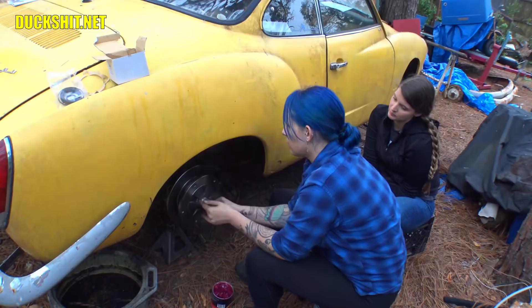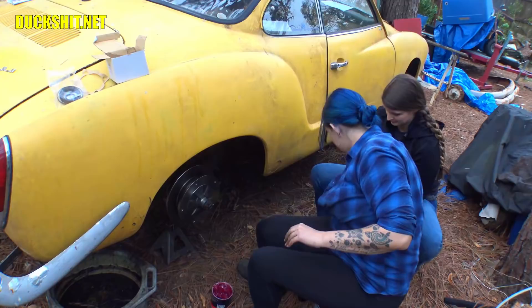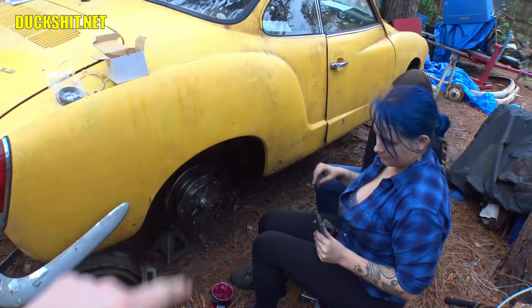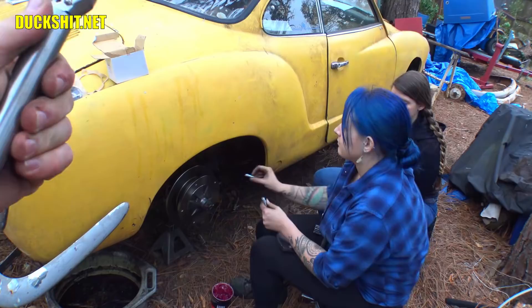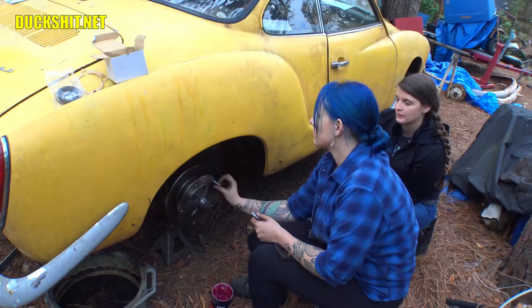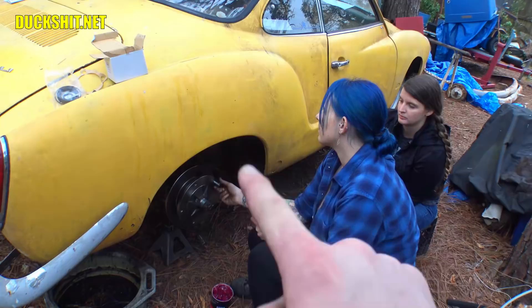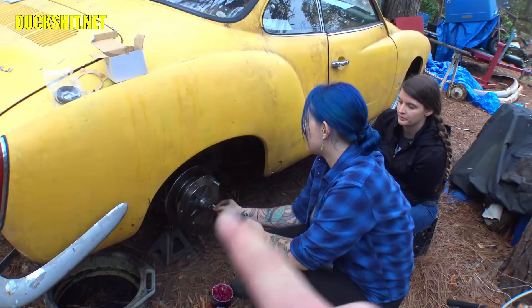This one has to get torqued too. Don't be afraid of greasing up the nut when you put it on — grease up your nut; it's good for it because someday you'll take it back apart. Some people like to impact these on — big no-no, because you don't know what spec you're torquing to. Don't do that unless you're just snugging it and coming back with the torque tool. I usually dial it to 30 because the torque multiplier will multiply that to just over 250 foot-pounds — 250 is where you want to be.